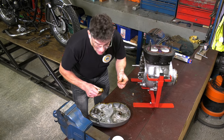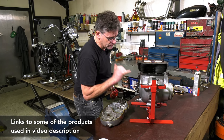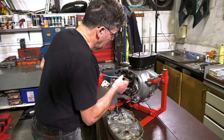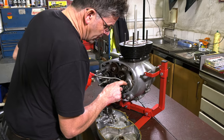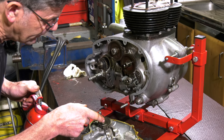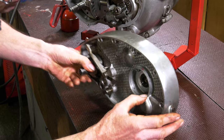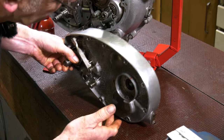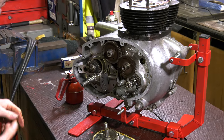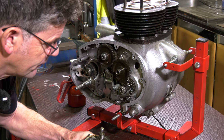A mascara brush is brilliant for applying the well seal. We've now got the well seal around there and the gasket on. With the intermediate gear, we'll put some oil on here because this goes through a bush in the casing and there's an oil seal at the other side — just not too much or it'll drip down to the gasket. We'll also put some oil around the kickstart ratchet mechanism. Always make sure the oil seal has got oil inside the lip. Now we're ready to put that on — just make sure all the holes are lined up, selector forks in the right position, and we can push this case back on.